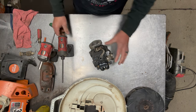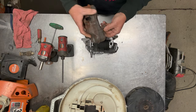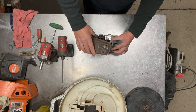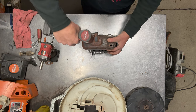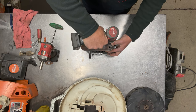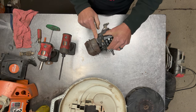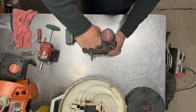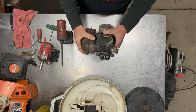I'll just go ahead and spin it to make sure it's not hitting. Next I'll go ahead and throw the muffler on — the short block does come with a new gasket. Set that gasket in place, line up your holes. I like to get all three of them started first before I start tightening them up, just make sure the gasket's in place before I finish it off. And that's all you need for the muffler — that's good to go.